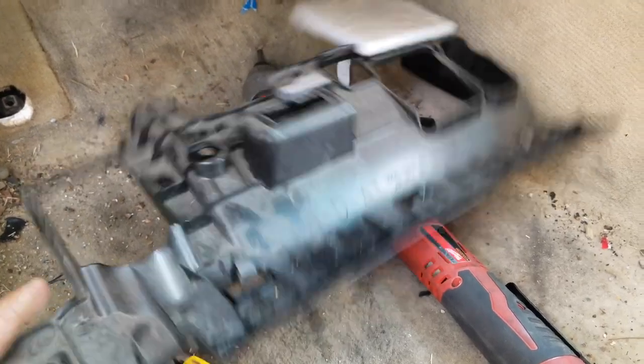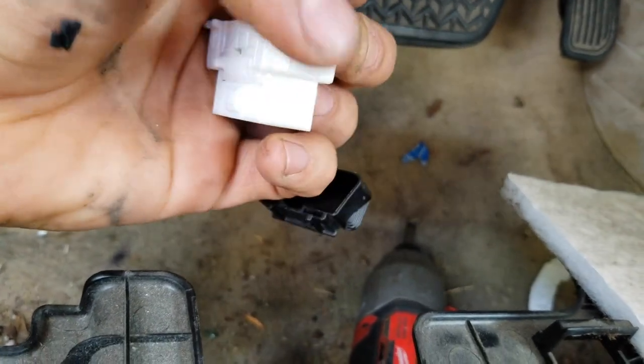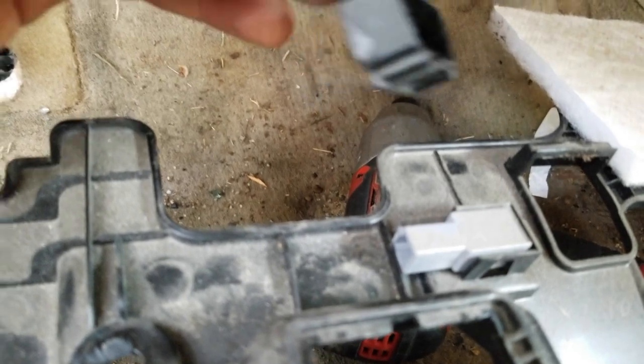It's a black plastic cover and you can see it has the OBD2 connector and a little LED light. I'll remove this bolt and this one right here. You need to know that for this first cover you have the OBD2 connector and you have to move these little hooks. You also have this little connection attached here and the little connector for the LED light — those are the only three things you need to remove. Also on this little plastic piece you have this metal piece hooked into the plastic, so you have to be careful. Don't pull it immediately after you take the bolts — first check what you might break.